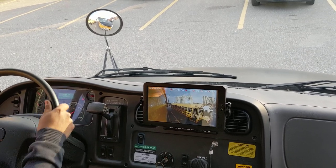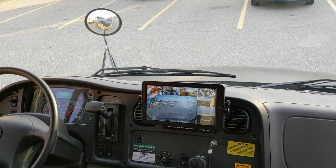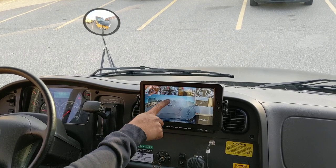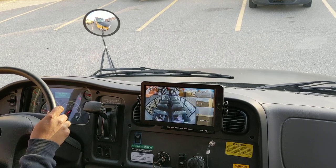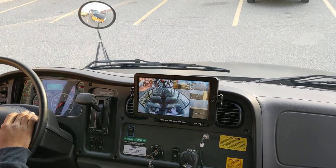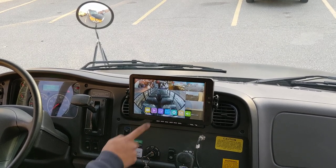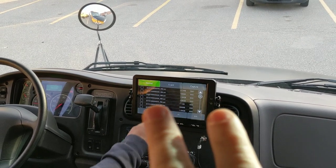Not only is this a surveillance option to capture video, it's also a driver safety option to improve the safety and performance of this bus. This DVR has many different capabilities — one of them would be remote viewing via cellular; it does have a cellular modem in it and Wi-Fi capability, so if the yard where the bus was parked had Wi-Fi coverage you could remotely view the DVR contents. It's capable of handling up to two terabytes of storage through a standard hard drive or SSD, and you can also put SD cards or a USB key in it for backups.